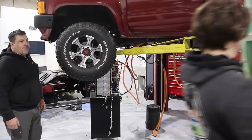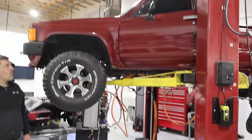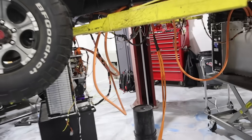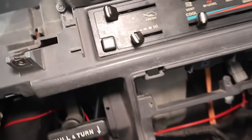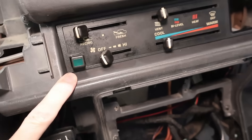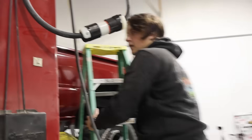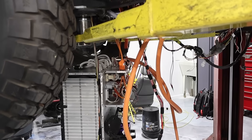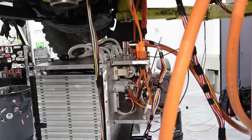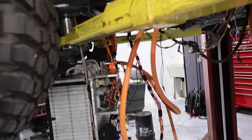We've got things in place, ready to test AC. We just refilled the AC. The main thing we're looking for is just the pump to come on — we'll look at some of the circuits and make sure everything's functioning normally, nothing's hot, no blown fuses. For this truck the AC is just a button on the dash, that's how it was from the factory. Going to turn the car on and push the AC button to get the compressor to kick on. We heard a click but we don't hear the pump yet. We need to turn on the command wire.